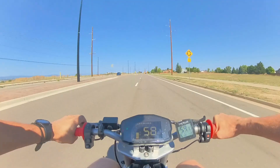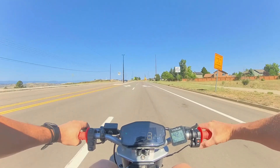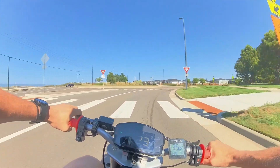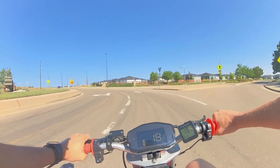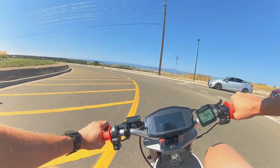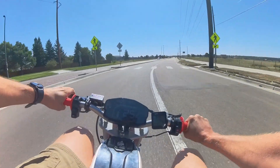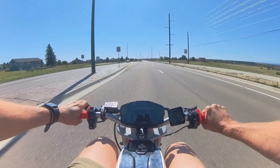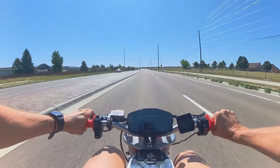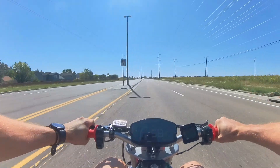We're clocking 59 mph — she's still got some pickup in the 40s too. That was pretty gnarly. Looks like the top is right around 60 with this setup. I think if we drop down to about a 4.9 or 5.4 gear ratio we'd probably be hitting that 60 more consistently. This stretch is pretty flat — and I forgot to screen record, but there's 60, we saw it.